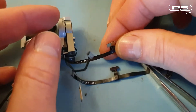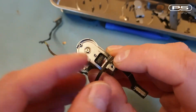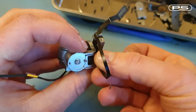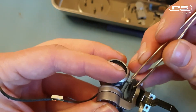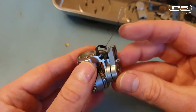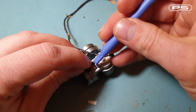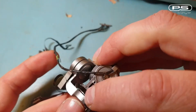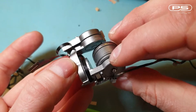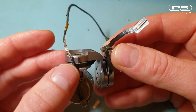Let's see if I can replicate that. Now I can carefully thread the roll connection through the yaw motor arm with the little help of tweezers. Connect the yaw motor, making sure it's seated right. Peel off the backing to expose adhesive and connect the roll connector to the roll motor. Stick the ribbon to the motor body, loop it right around making sure it's not twisted and has enough room to flex when the motor arms are in action. This is applicable to all three axes.